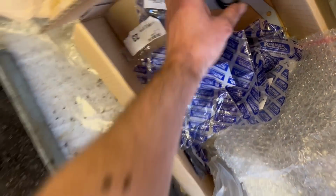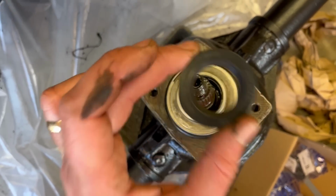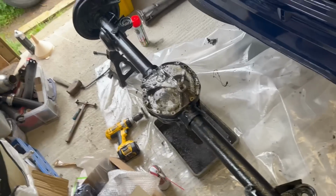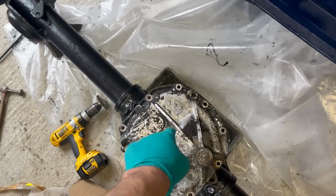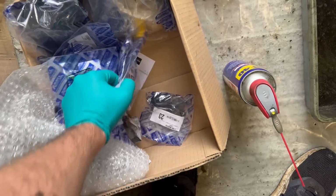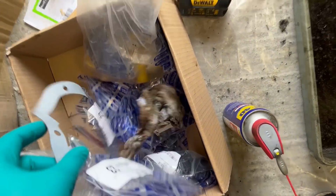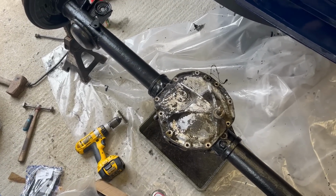So that can just be lubricated with a bit of oil and then dropped over there carefully and then pushed in. It's another day. I did the seal and then I forgot to show you the results, so now I've turned the axle over. I can't be bothered to turn it back the right way to show you. But now, rear cover off, clean that up. We've got a new paper gasket under here somewhere for the rear cover, so that can go on, bolts torqued up.